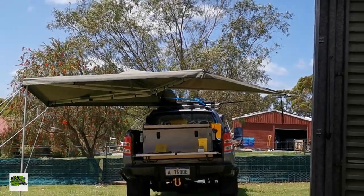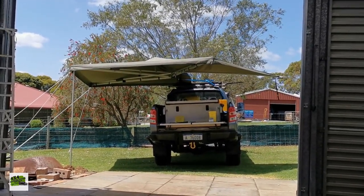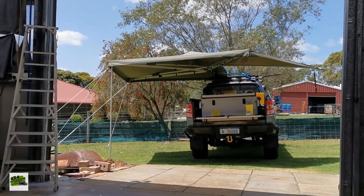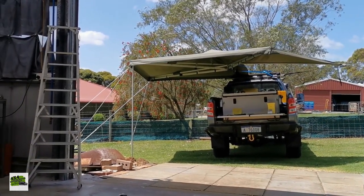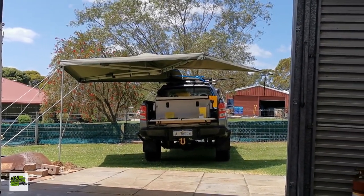When it gets open to 90 degrees, the torque experienced by the main awning body is the greatest. We didn't think about it before we put the brackets up, and we have to actually rely on the guy ropes to avoid the awning from being destroyed by the winds.